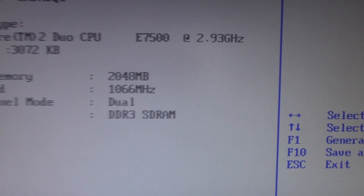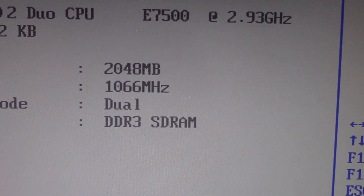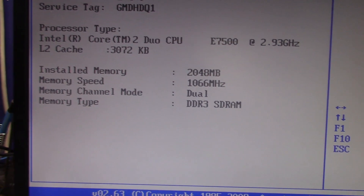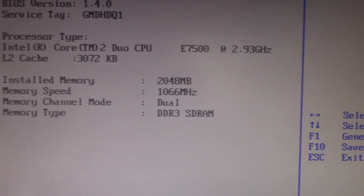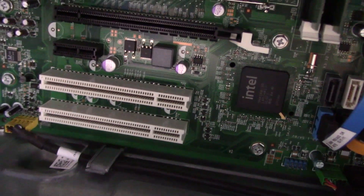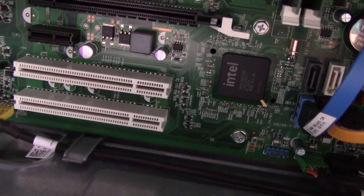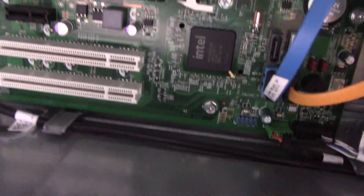Here's the bigger problem: we only have 2 gigabytes of RAM — DDR3, two 1-gig DIMMs. I may have some RAM lying around to upgrade this, but I don't know if there are free RAM slots. Both RAM slots are populated. The machine does have a PCIe slot — one 8x or 16x and another 1x or 2x — and it also has regular PCI slots.